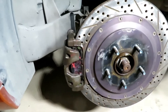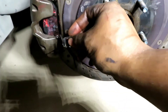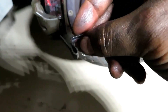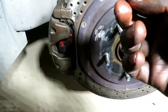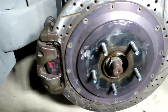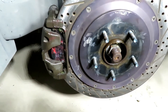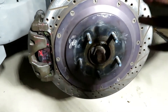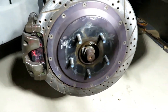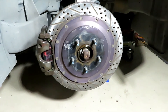I got the pads on. One thing I did because I was having so much trouble getting the pads in — I broke off the wear indicator clips. These clips let you know when your pads are too low, but I'm good at checking my pad thickness visually. I broke them off on the other side too — they make it a really tight fit and cause a lot of headaches. Other than that, it's pretty straightforward: I'm gonna tighten down the caliper bracket bolts, put anti-seize on all the lug nuts, torque them down to 100 pounds, let the car down, and bed the brakes the proper way. If you haven't been to the channel before, please like and subscribe. If you have any questions on why I did certain things, just go ahead and ask. Thanks for watching.